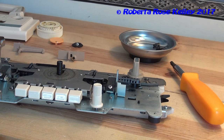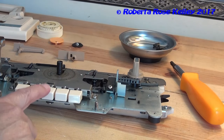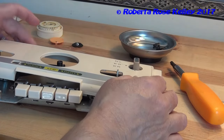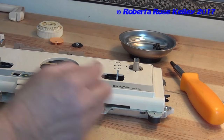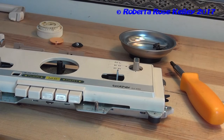Maybe take a picture of what is on there. Now, these buttons aren't going to come off, and of course this is the 830 — you do not have the separate two middle numbers there. But basically that's all it is. So after I wash it, then I go ahead and just in reverse put the cover back on, turn it upside down, replace those two screws on the bottom, put the dial back on, put the handle back on, and I'm all set.